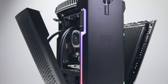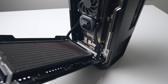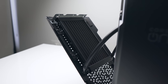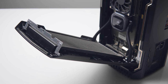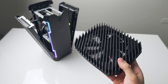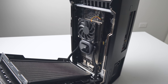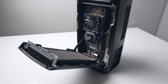The best part about the Corsair One is the thermal design. Both the CPU and GPU are liquid cooled, resulting in great noise and thermal performance. The 9900K and 2080 Ti are hooked up to fairly OEM-looking radiators with no fans mounted to them — only 20mm thick and not a standard size. The radiator for the 2080 Ti spans the entire length of the side panel, but primary cooling relies on that single 140mm exhaust fan at the top. The 2080 Ti gets some additional cooling for the VRM and memory modules via a slim fan. The exact 2080 Ti used is the MSI Ventus — MSI's entry-level 2080 Ti — but no problem since it's liquid cooled anyway.